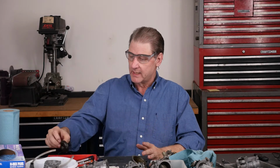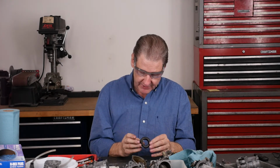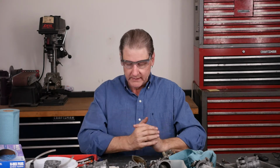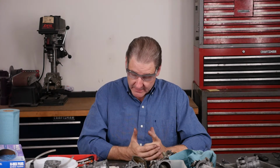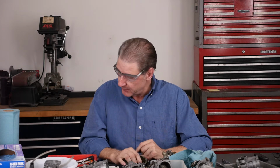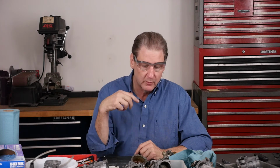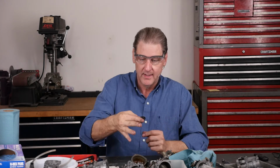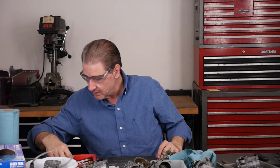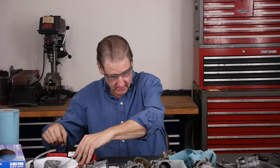I'm even going to ultrasonic the float. This float isn't too bad. It's in much better shape. I guess most of the grunge ended up in the bottom. And we'll get that figured out. There was gas in the carb. I'm really surprised that the accelerator pump, as good as it looks, I'll put a picture up somewhere here. Here's one. Look at this one. How's that for a diaphragm? We'll compare it to the, of course you always lose the thing you're looking for.